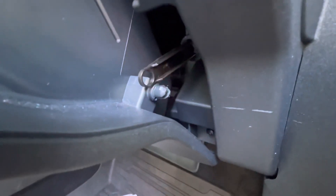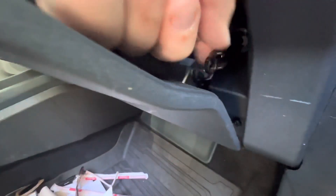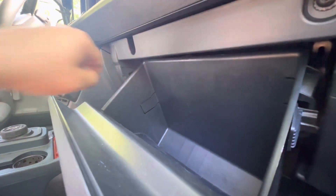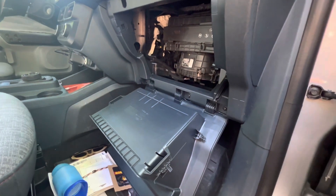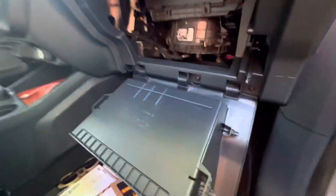That's just a little plastic fitting with two halves. I simply took pliers, squeezed it, and pulled this little retaining clip off — just be careful not to break it. There are also two clips on the glove box you want to push in. Push them in and simply tilt the glove box all the way out. It's not too difficult; I'm sure you can do it.